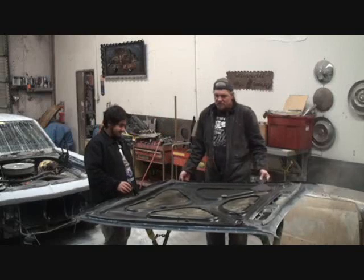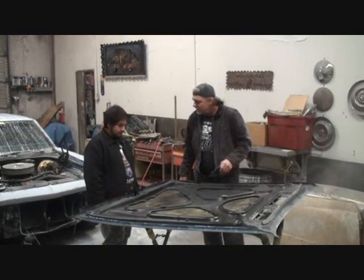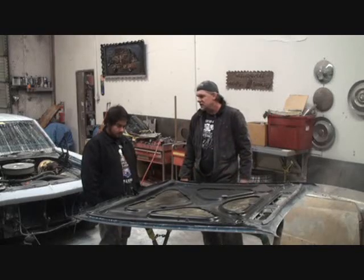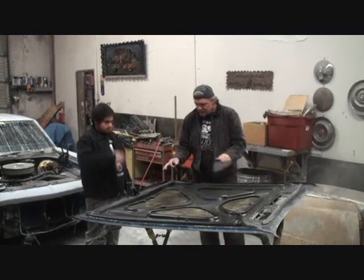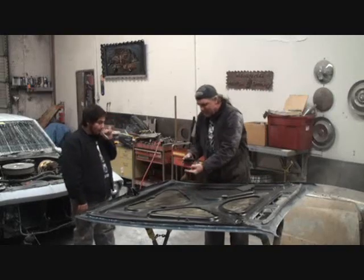First of all, we have the hood upside down, and it's on this stand. You don't want to push hard on this hood, because you will dent it on the outside, and I am going to be pissed that it's dented. The next thing you're going to do is take a Scotch-Brite. This is a gray Scotch-Brite that I cut in half. We also see that this thing is filthy dirty right here. Look at my finger. Look at that. So we can't just go ahead and paint this hood with that going on.